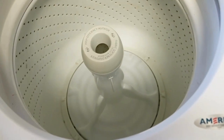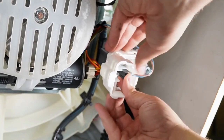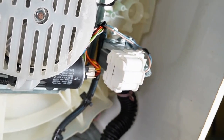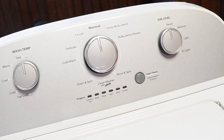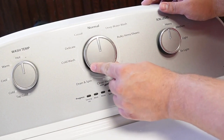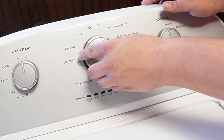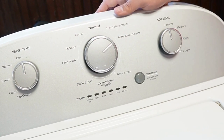Now that we've done the first reset, let's go ahead and attempt to recalibrate this washing machine through the calibration mode. This is a must-do if you've installed any new parts on the washing machine, from a board to a balancing rod. With the washing machine freshly rebooted, you want to rotate the dial again counterclockwise 360 degrees. Then you'll turn the knob right three clicks, left once, then right once again.